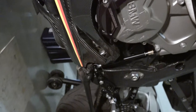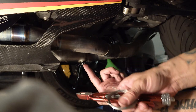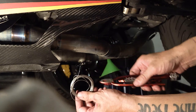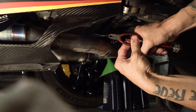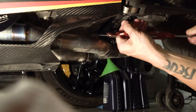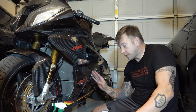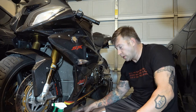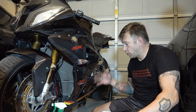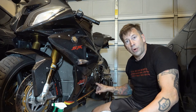Now I'll reinstall that panel — everything is filled and looking good, no leaks. Panel reinstalled. If your plug was safety-wired before and you need it safety-wired for a race event, make sure you don't forget to redo that at the end of the job. With that complete, all you have to do is take it out, ride it, and then once you've ridden it a few miles, make sure there are no leaks underneath. Keep watching that for a while. Most bikes will have a sight glass like this one, so after you've run it, come back and check it per the manual to make sure it's reading properly as well.